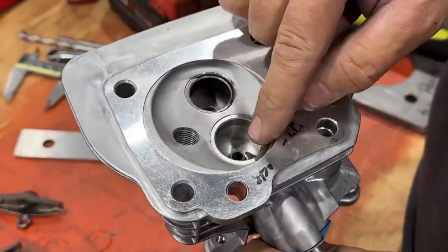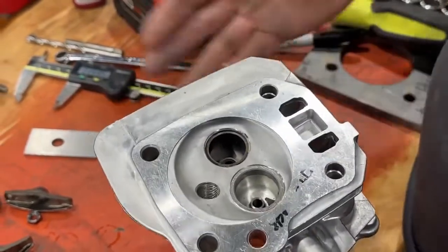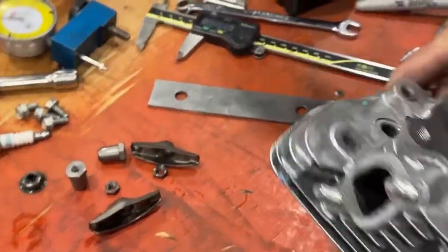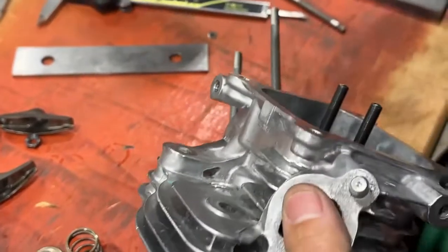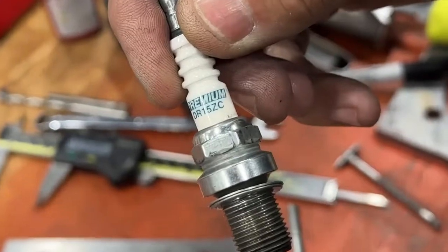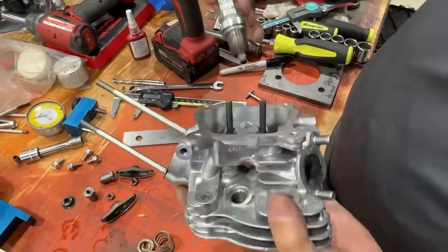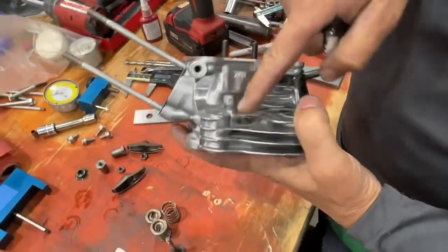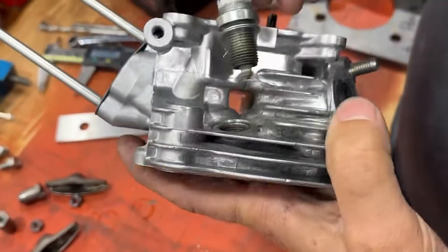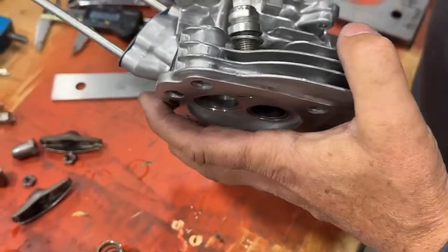We did accurately measure it and it came in a little more accurate than using the dial caliper. Moving on to the spark plug — you can run any automotive spark plug, and we like the Brisk DR15ZC. In the book, it doesn't give a dimension for this little spot face anywhere. But it says no machining, grinding, sandblasting, and a list of other things.